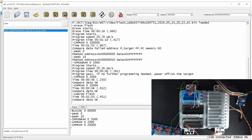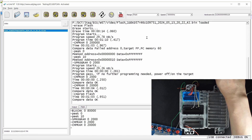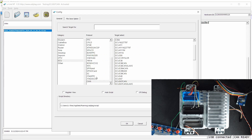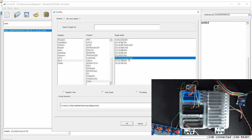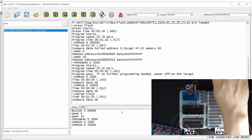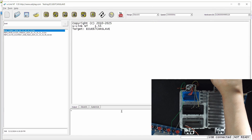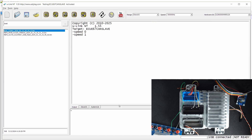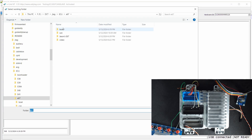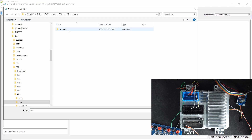The hardware setup will be identical — I'm not going to change anything. I just power off and then re-select the power of the ECU. I'm going to select the target as the E67 slave. You cannot select the other slave because the initial negotiation is different. So I'll power off and switch the target.